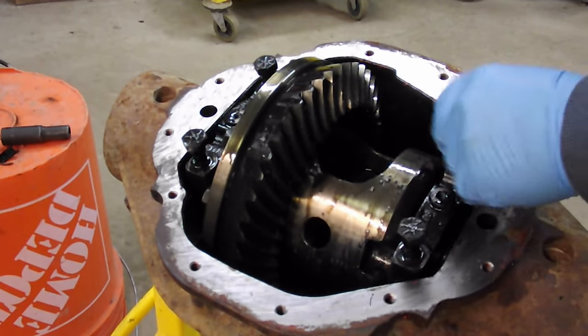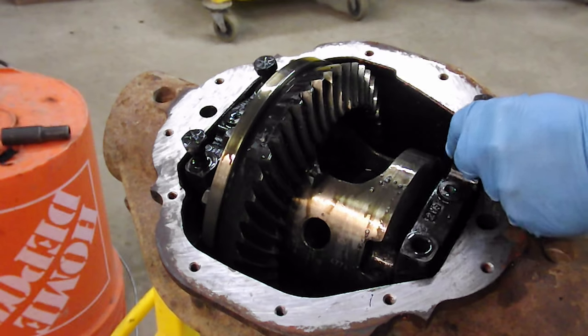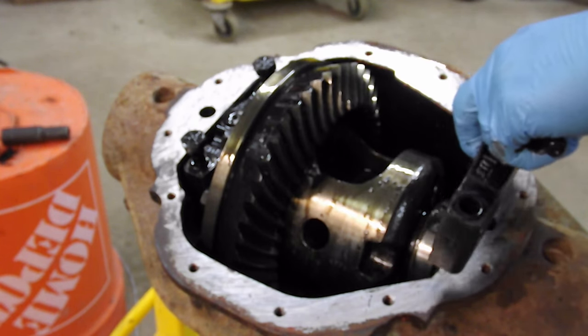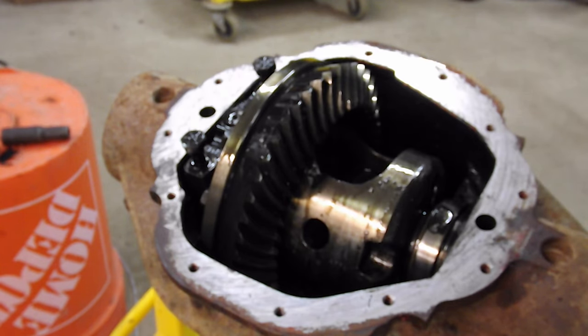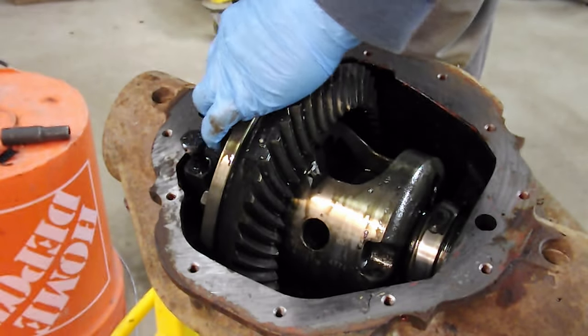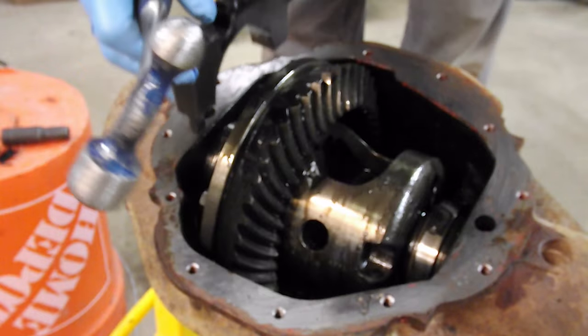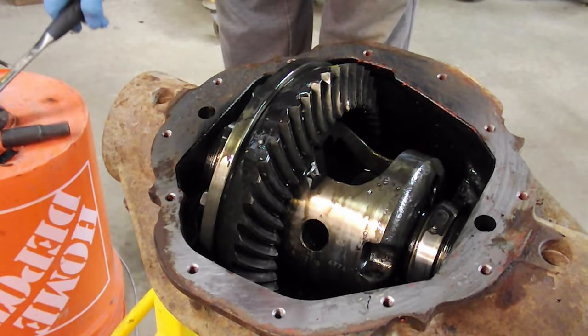I've loosened the bolts. What I'm going to do is take the bolt, stand it up, and give it a hit. You always keep these in the order that you take them apart and the side you take them apart - you don't want them turning upside down or backwards. I usually set them in a tray along the back side of the vehicle.